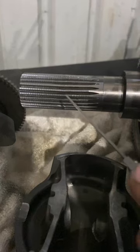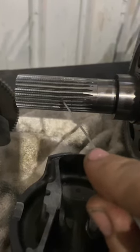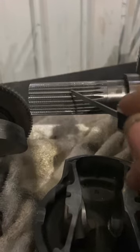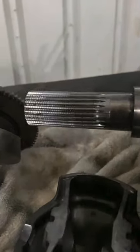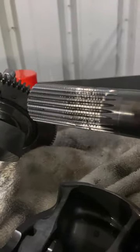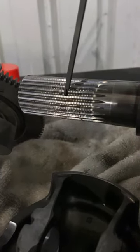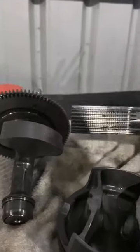Now with the pistons aside, we're going to go through some stuff with the crank. Our driveline side has started twisting — we can see there's a ridge or a knuckle there. From here outbound we've seen a twist. There are little dots indicating where there's been a shift. Off my eye I can see it quite easily; for you guys maybe not so much, but we are twisting.